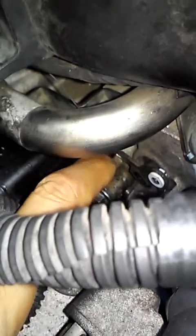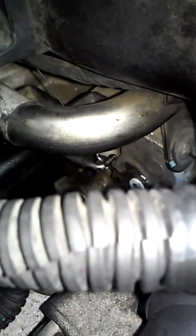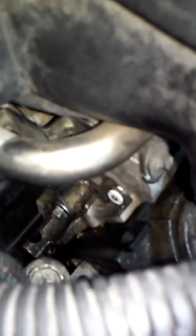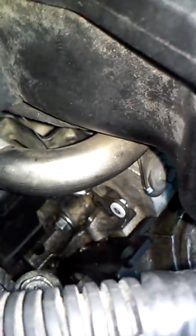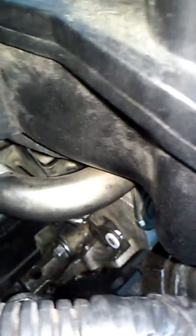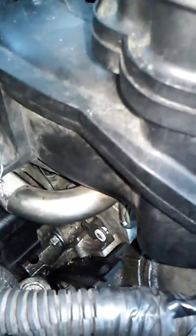The issue was these little sticks that you see down there. They actually attach to that little bushing, and that's the little stick, which is now loose again because I actually purposely did that. They were loose. They come loose because the bushings tend to dry up and break, and therefore the little stick comes out. That happens obviously with years. This vehicle has 100,000 miles already.